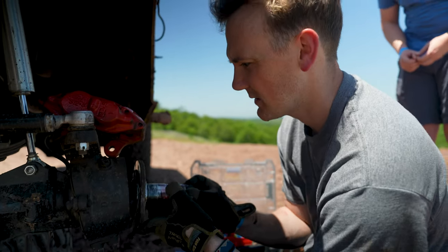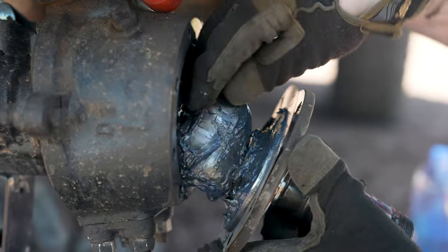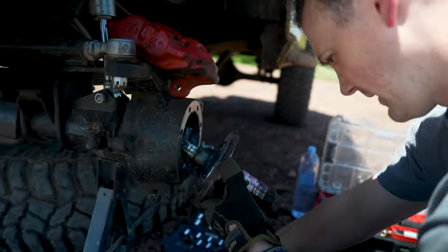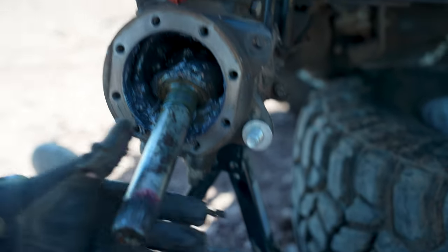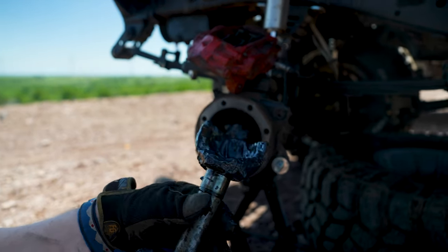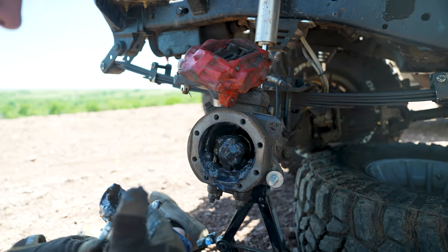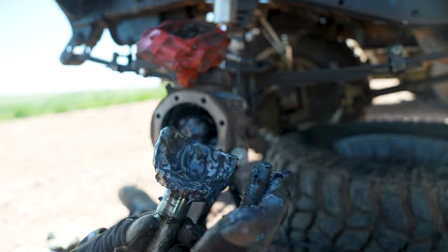Alright, we're good. Okay, so here we go — spindle's off. There it is. So there's that birfield joint. You can see that used to, should have been one piece. You can see the little ball bearings in there — all those sit on the inside of it. That should have been one big nice ball. This is why you don't want to drive with it the way it is — all those bearings and everything rumbling around with the broken pieces trying to spin. You can see there's that outside birfield, which is actually probably a good thing, because I think this is just the piece I need to replace — the outside birfield joint. You can see that used to be all the way cylindrical.